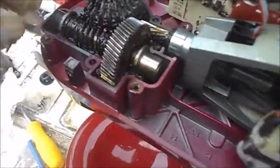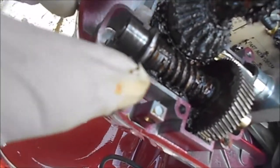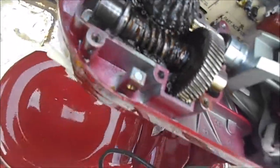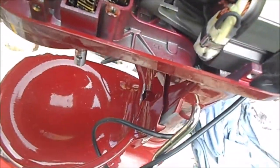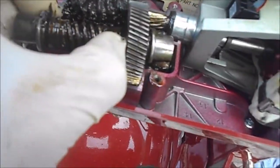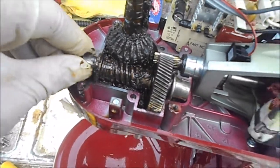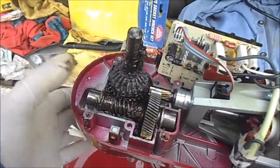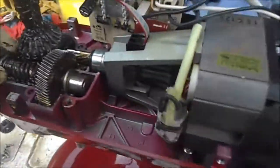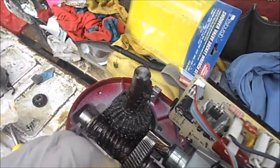You want to watch how this thing is mounted. These bushings are sort of oblong — the rounded edge goes up. Some of them will actually have a special roller bearing inside here, and some of them don't. This one just has one single washer, and it can be a bit tricky to line that back up, but you want the rounded edge up.